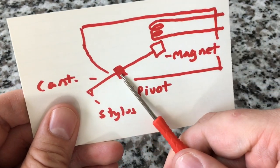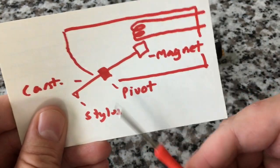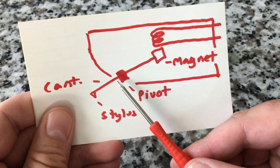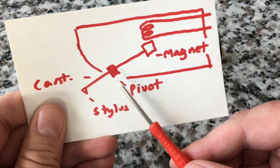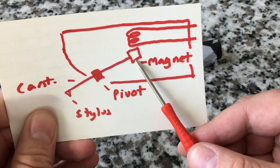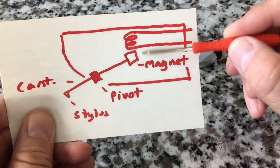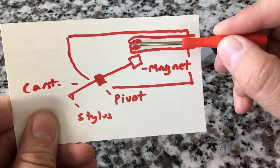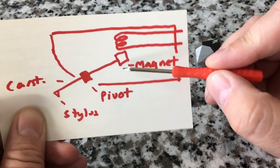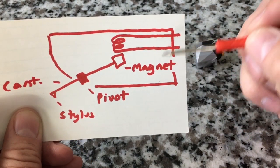Following the cantilever up, there's something called a pivot or joint — usually a piece of rubber, although on super cheap ones it can be plastic. This pivot allows movement of the cantilever and thereby the stylus to move freely and smoothly. On the other end is a magnet. When the stylus moves because of the grooves, it moves the magnet on the back end, which is right next to the coil. So a moving magnet cartridge has a moving magnet that impacts the electrical signal because of the proximity of the magnet to the coil, which connects to the wires on the back of the cartridge.